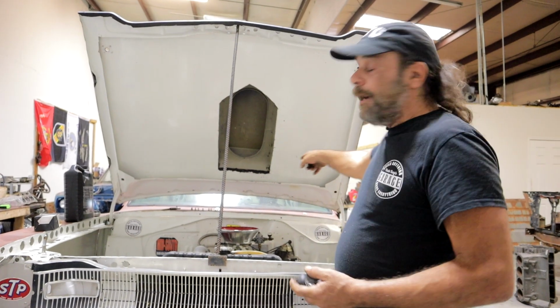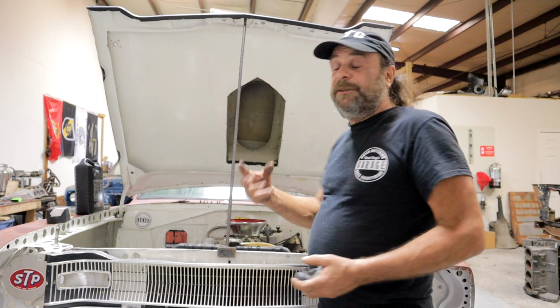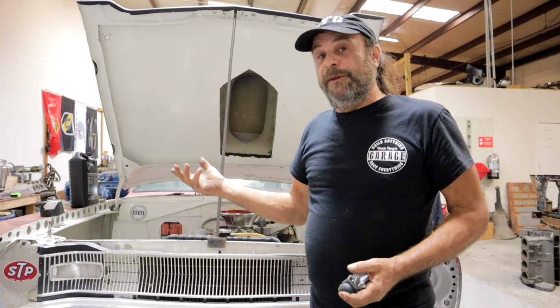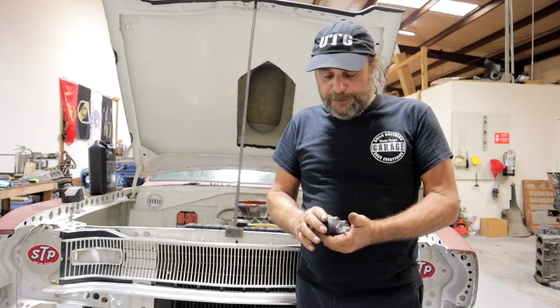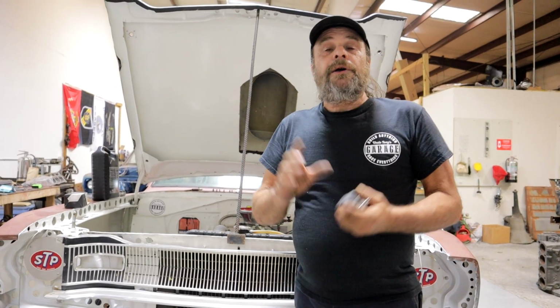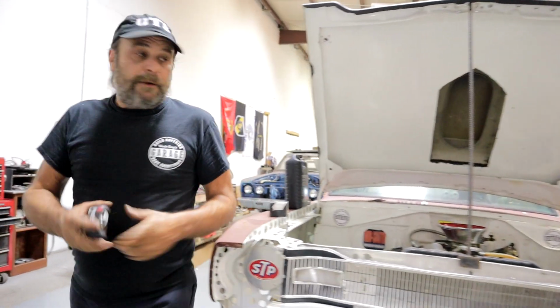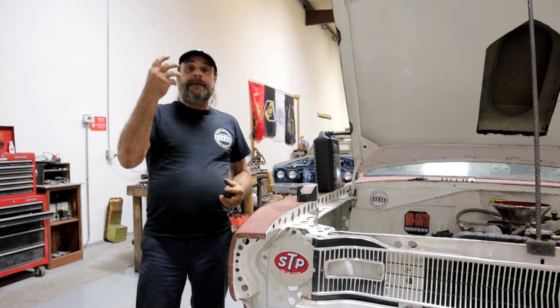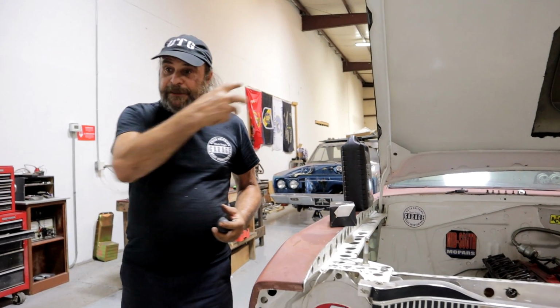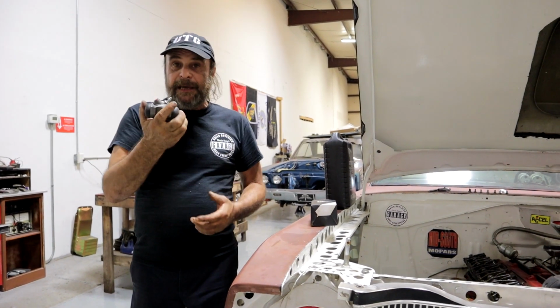Evidently, there's no problem with the back brakes. The reservoir for the back brake seems to have sealed well. It's the reservoir for the front brake. You can even see by the fluid had that contaminated look to it. So it doesn't matter if you're dealing with a drum brake car like this is, or disc brakes. The principles are all the same. That moisture in the brake fluid is going to gravitate to its furthest point, and wherever it gathers, it meets cast iron and it rusts. And that's what happened here.